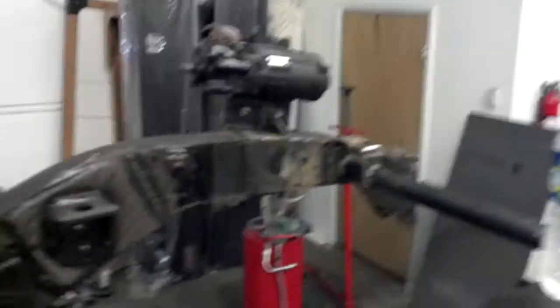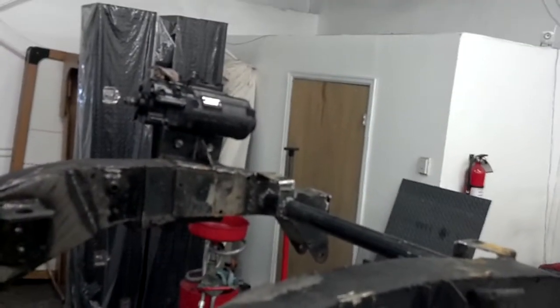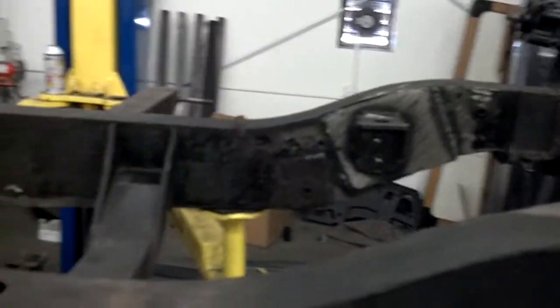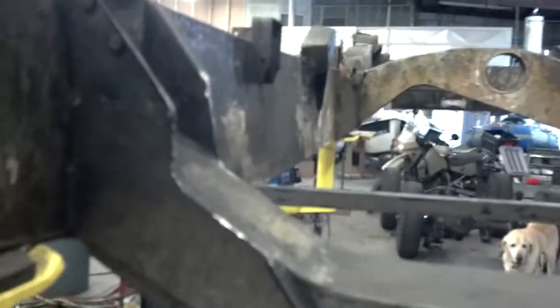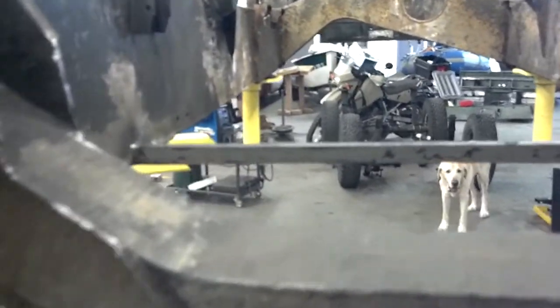The front end really took a lot of changes. You'll notice one cross member is missing here also — we replaced that with a new front end. Then you see the power steering mount that we've done work on, new engine mounts from Advanced Adapters. Some modifications have been done here to allow room for the front drive line to come through, and then an entirely new mount for where the transmission will sit, yet to be drilled.